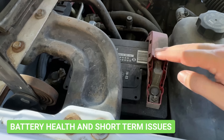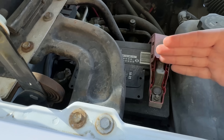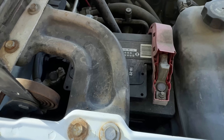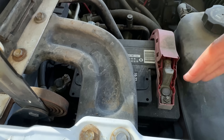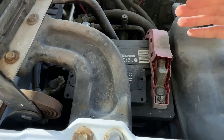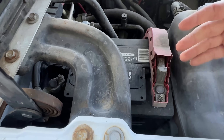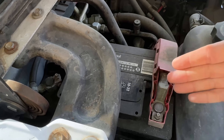The next thing comes down to your battery's health. Some symptoms your battery displays can be either acute or chronic — we'll get into the chronic ones later. For the acute ones, pretty much all of us have been there where we go to start our vehicle and it just won't start. Sometimes it appears completely dead with no noise and no lights. Your battery may be severely depleted, or somebody left the lights on overnight, depleting it far enough that it won't turn the engine over. Many people are still carrying around those big bulky jumper cables.